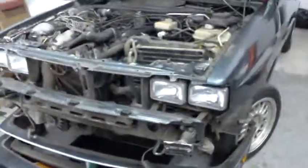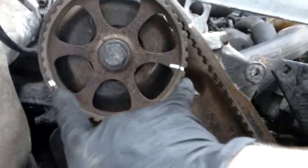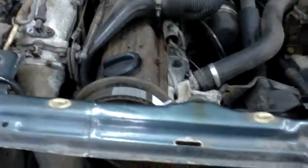Okay, this is gonna be — we'll call this attempt number three. Found out there was a different mark on the back of the cam gear. You can see the split between the two marks was way off. Now peeking through the oil filler cap, I can see that the cam is much more in the correct relation.